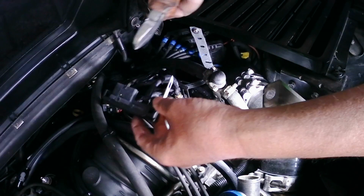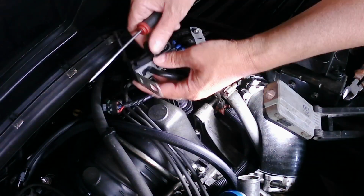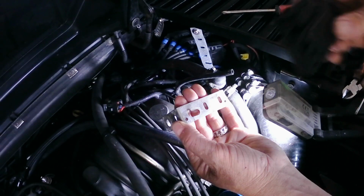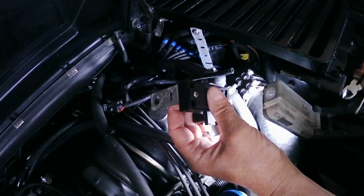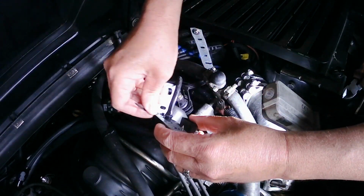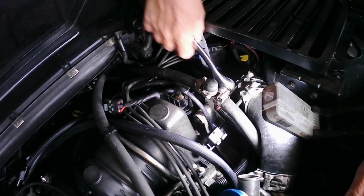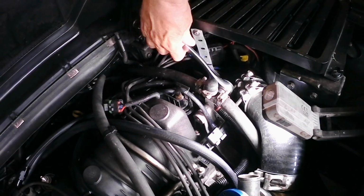Now this car is a low boost setup, and the fuel tables on the ECU will compensate into boost without needing a working MAP. In fact, even if the MAF dies as well, then the ECU just reverts back to speed density calculations and will still get you a reasonable time slip. And it'll get you home after the race, albeit stalling at every single traffic light and junction on the way back, but whatever. Anyway, I need to replace the MAP sensor.